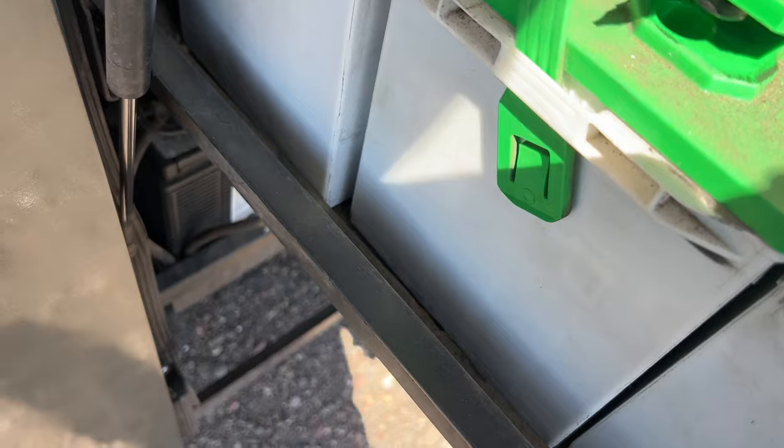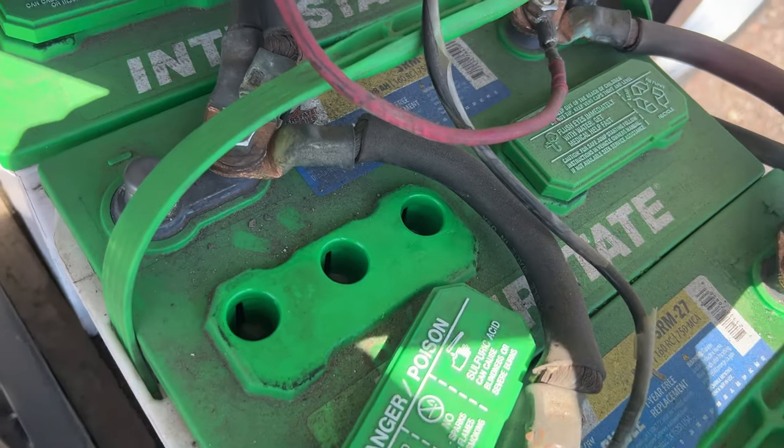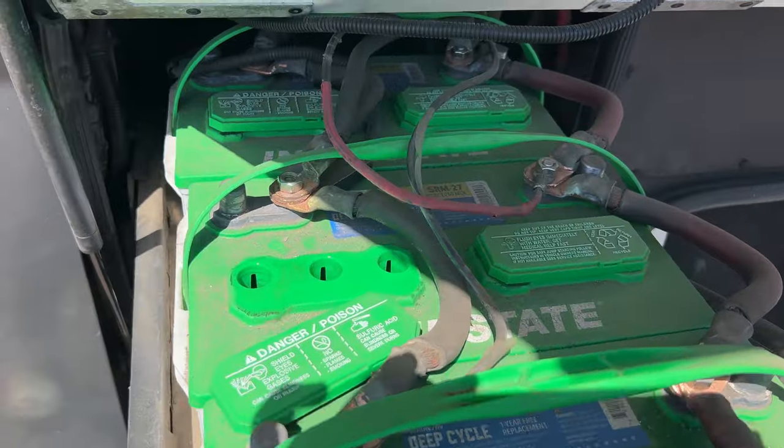A full charge battery is about 12.7 to 12.8 volts. If your battery gets down to the low 12s — 12.1 or 12.2 — you might see flickering lights and things not working as they should. If you have a lead acid battery, you also need to maintain the water level. Remove the little plastic cap, look inside, and make sure the water level is up near the top — use distilled water, not regular water. I'd check the water level every month or so. If you have AGM batteries, you don't need to worry about that, but they still need to be trickle charged.